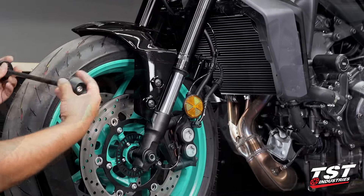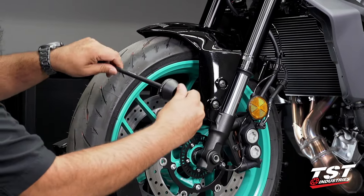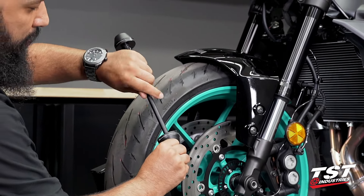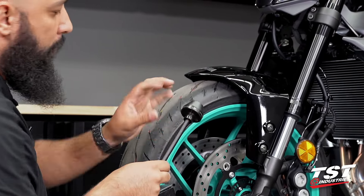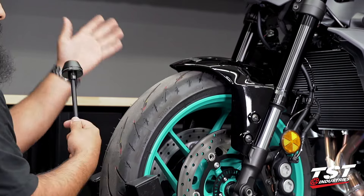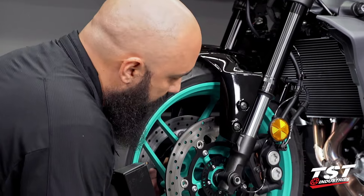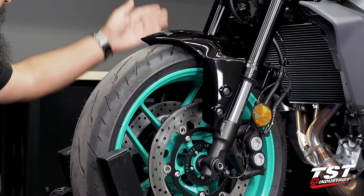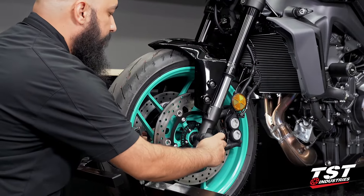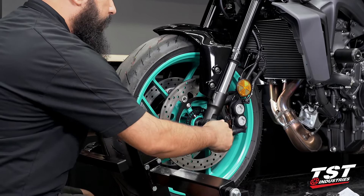Sliding over to the front of the bike and orienting our fork slider in the way it will be assembled, I will now go ahead and remove one end of the assembly — in this case, the clutch side. With that removed, we will tighten this by hand and bottom it out against the brake side of the assembly. We will insert it through the axle and bottom it out. Then we grab the opposite side and begin threading by hand — always start threads by hand to avoid cross threading.